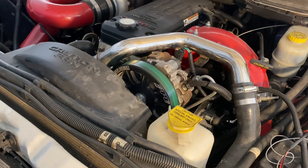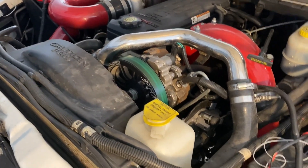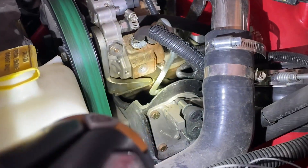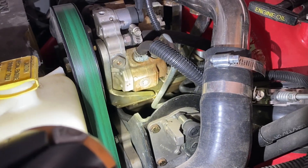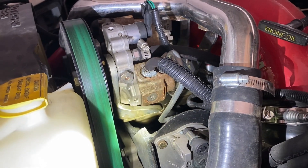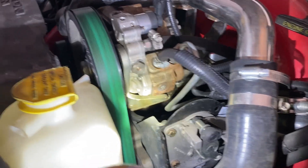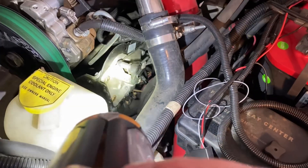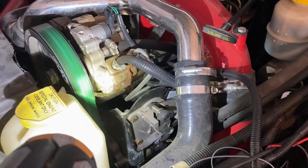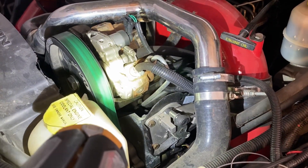The next thing I'm going to talk about is the way this second CP3 pump is mounted — this is the most important part of this video. You can see there's a flange that's actually part of the engine block that this thing mounts on. On a 2003, that's where the transmission kickdown is located. The kit provides you with the provisions to move the transmission kickdown from this flange down, so you're able to mount the second CP3 up top on this flange.